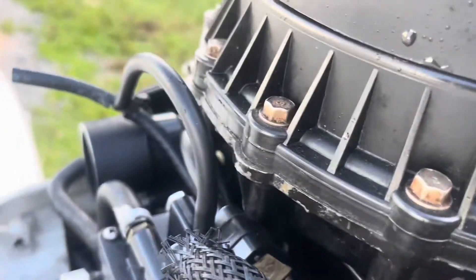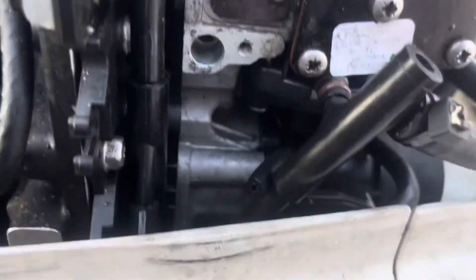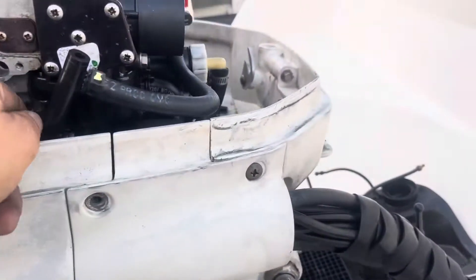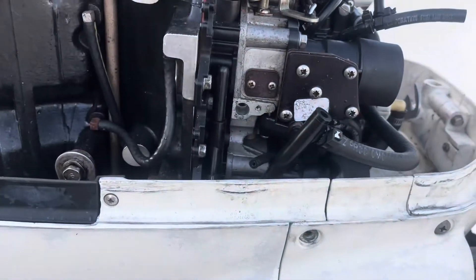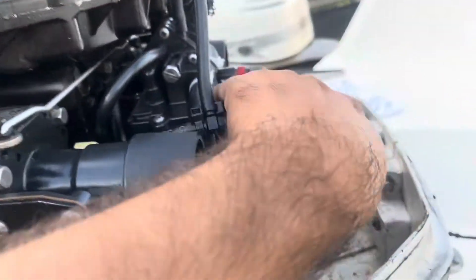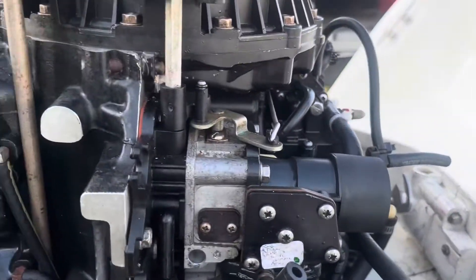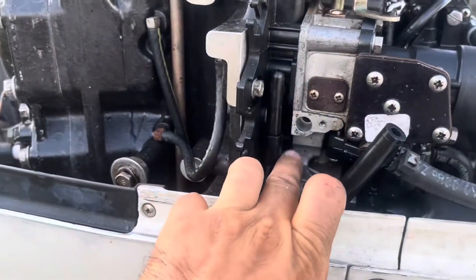This thing is very easy to test. All you gotta do is disconnect the hoses from here — where the hose goes in and comes out. It's a little hose — not a vacuum line, that is gasoline going straight to your cylinders. Disconnect it and crank it and prime with your key. If gasoline is coming out, then it's not the actual pump.